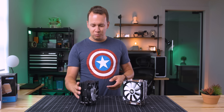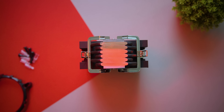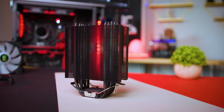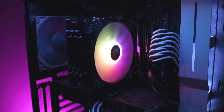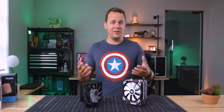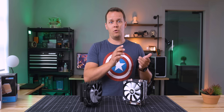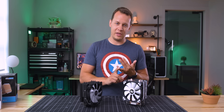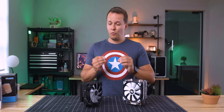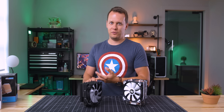The MT6 on the other hand — it looks like a blackout version of the MT4, but it's not. It has six direct touch heat pipes, and the version we had actually came with the AMD AM4 installation package pre-installed, which seems a little weird. I went out and purchased the ARGB version, but there's also an RGB and a regular non-illuminated fan version — so if you want to save a couple of cents, you can go with a lower-end version. The same applies to the MT4: you can get it with RGB, without RGB, and with ARGB. What I really wanted to get into is the installation of these things, and it really surprised me — because at one point it's really good, and on another cooler it's the most trash thing you've ever seen in your life.